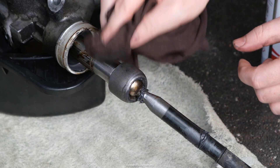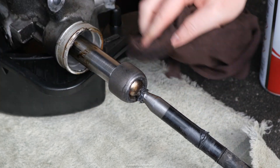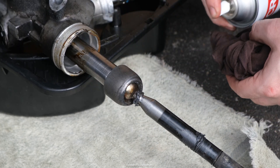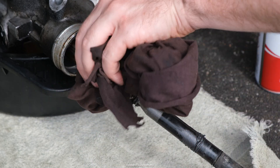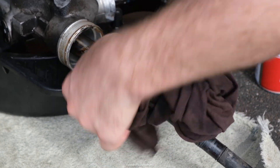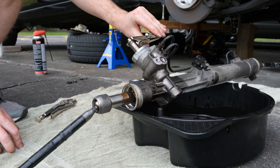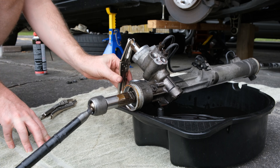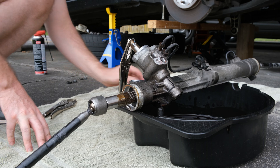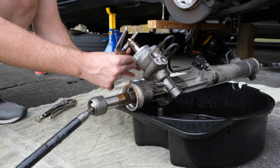The next thing is to get the rod unscrewed from the rack, and this is the tricky bit. The Ford workshop manual instructs that the rack should be removed from the car, as I have done, and then the rack bar itself held in a vice. Even off the car, most people in workshops are not pulling out the entire rack just to replace the rods, so it's a bit of a ridiculous assumption by Ford. The particular problem is that they don't provide any flats on the end of the rack bar, so as you try to torque on the tie rod, you can't provide any counter-torque to protect the rack — it's a real pain.